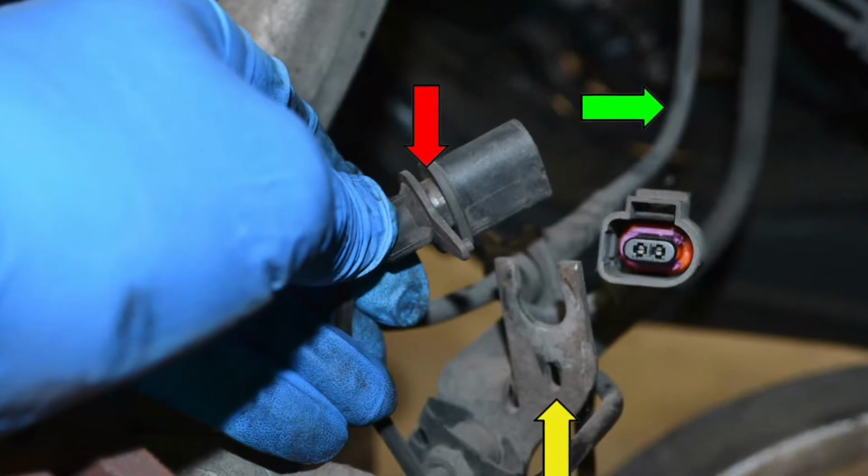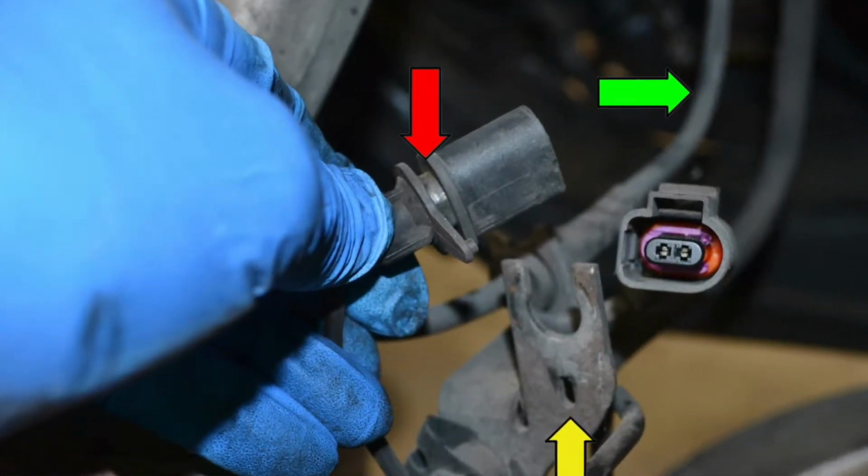The second thing to note is the sensor for the brake pads on this vehicle is on the driver's side. The driver's side has the sensor. Make sure your kit has a new sensor to hook into the harness, because I broke the old one on the way out, not knowing how it is. It's not that long of a wire, so when you pull the caliper off, you're most likely going to rip the wire out because it's very delicate. So make sure you have a new one.